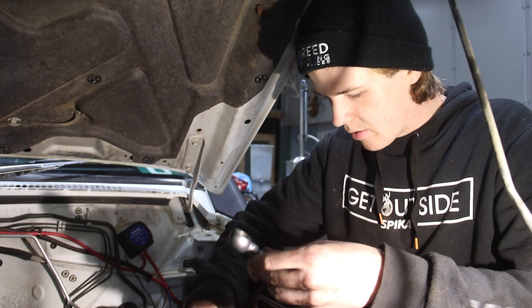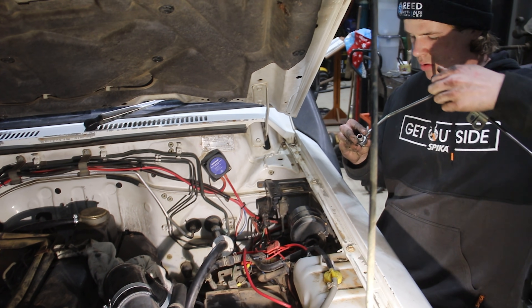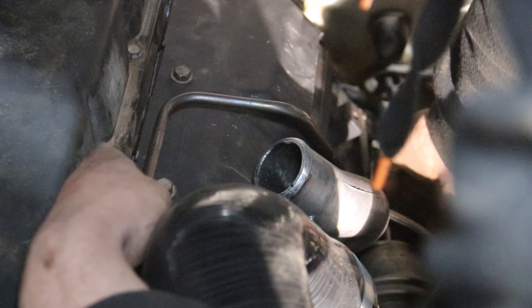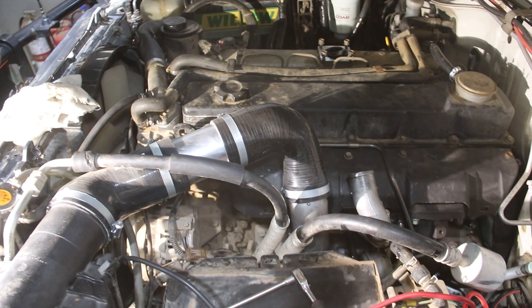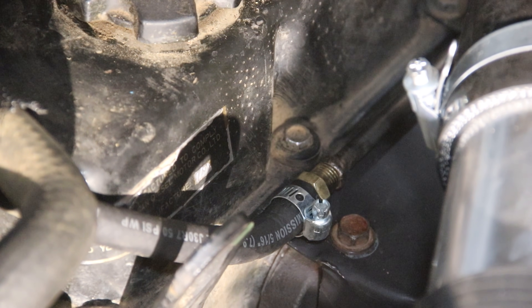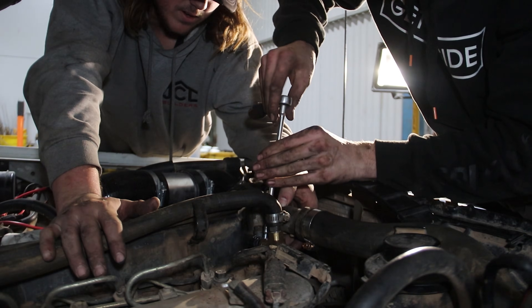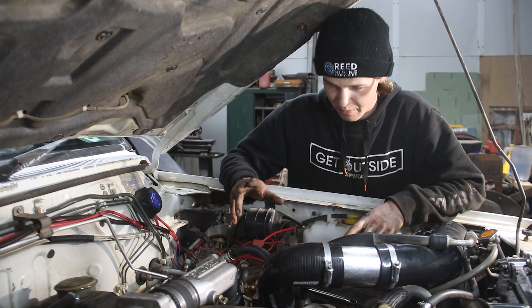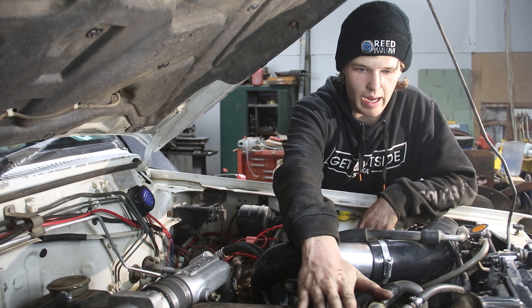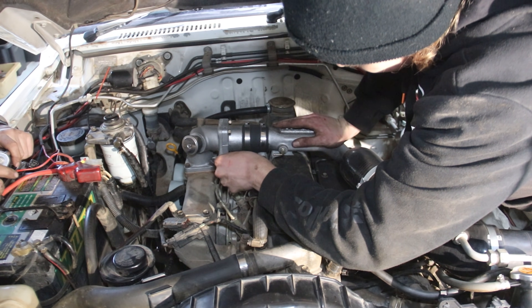Now we can mount the water lines up, and once they're on we can put the coolant back in. Still have to put on the crossover pipes, sensors, and sort out a temporary exhaust before I can get a full system made up. We've pretty much finished putting everything together — we've put on the coolant feed and drain lines for the turbo, both plumbed up, and the crossover pipe is all plumbed up too.